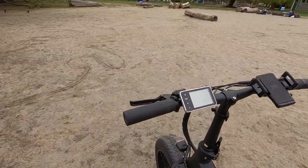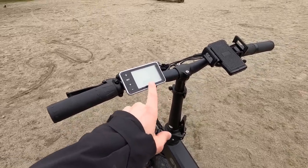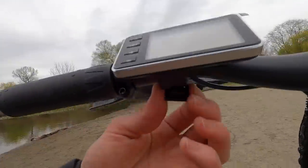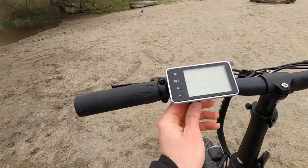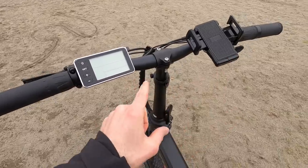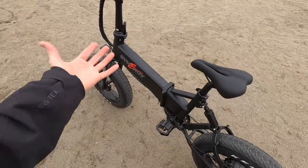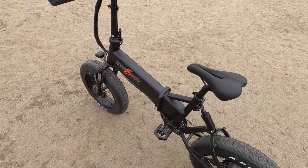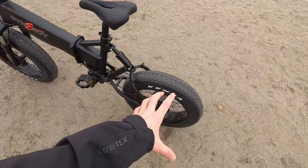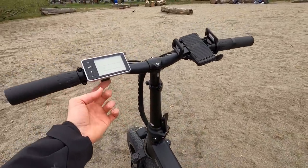Another highlight: in addition to the wired-in headlight, there's a USB charging port below the display — full-size USB Type-A, five-volt one-amp. You could have a little wire and charge your phone as you ride. This is a fairly high-capacity battery — 48 volts, 14 amp-hours, about 672 watt-hours — which is sizable. You need it with a higher-powered motor and less-efficient fat tires, especially if you lower the PSI. Being able to tap in with your phone is great.